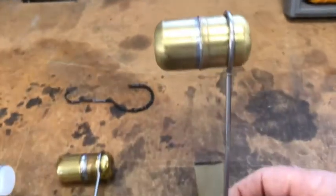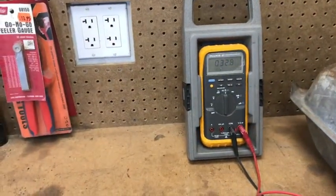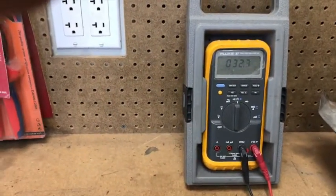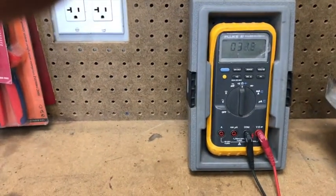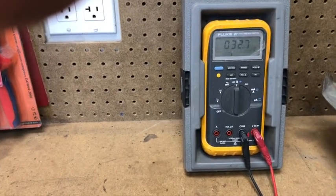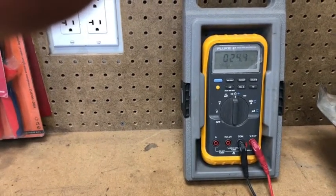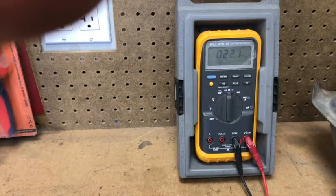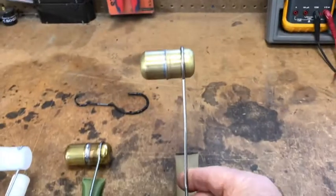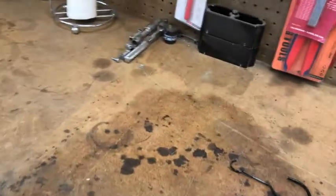The rheostat — I'm going to lift the float. I got the float up here, I'm holding it up. There's nothing I can do with the float to make that meter read two ohms. I'm jiggling the rheostat, I'm moving it up and down. It isn't going down to two ohms. When I put the gas in it, it was reading 21 and a half ohms — so that's where the float was on top of the gas. Two days later, I could not make it read more than two ohms and the gauge was empty.